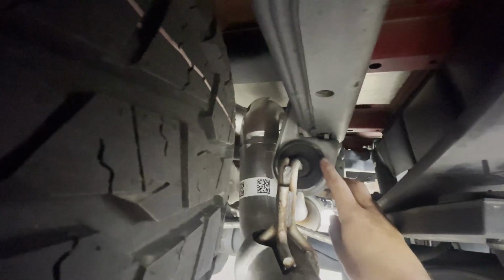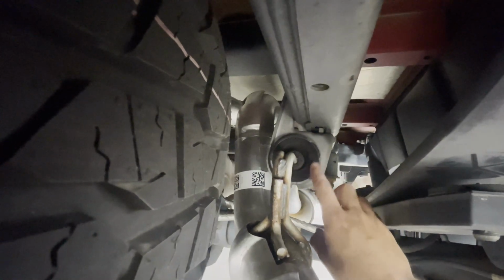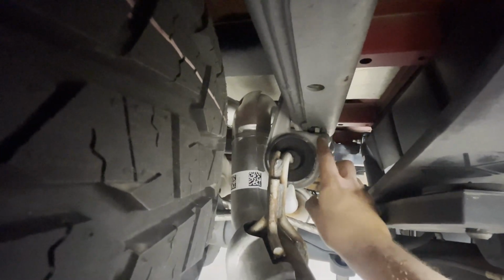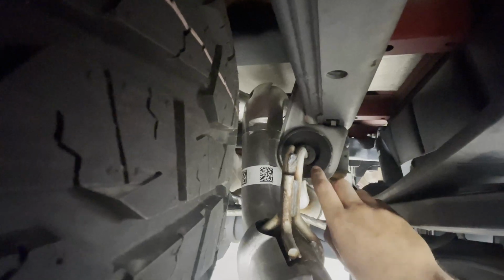And then some of the other things that you'll need are these, I think, intermediate hangers or something like that. I don't know what they're actually called, but this hanger right here. The stock exhaust uses this same hanger, so you don't need to buy the passenger side or the right hand side. What you will need to do is buy the left hand side, which is essentially this bracket but flipped around the other way. And the way that the bracket affixes to the frame, there are two square pieces right here where you just slide in a C-clip nut thing, and then get the bolt that goes into there. I'll show you guys on my workbench what those look like. But essentially it's the same thing as on this side, except just flipped around. So you really only need to get that left hand side as long as you have this stock exhaust hanger. And everything else uses literally the same mounting pieces.